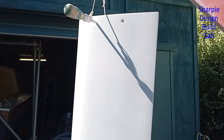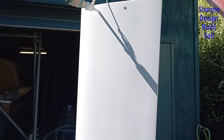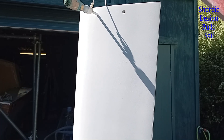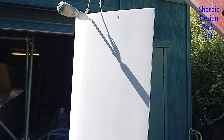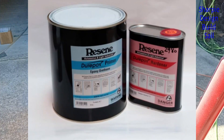The sun is quite cruel and showing up any imperfections. That's very heavy paint to be spraying through that gun I was using — I think it's a 1.5 millimeter nozzle, which is supposed to be the minimum you can use. Getting heaps of overspray because I'm having to push so much air through to drag it out of the pot, and that's with adding 20% reducer thinners. It's a much better finish than either rolling or brushing, but to get most of the marks out you have to sand so much of it off — because it's not self-leveling — so that's why I was going to give spraying another go.